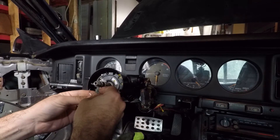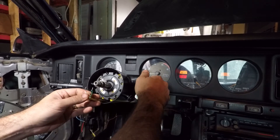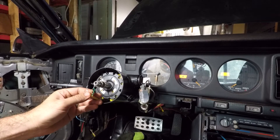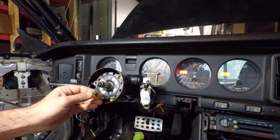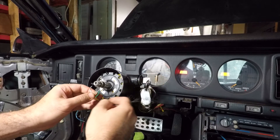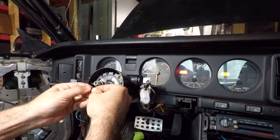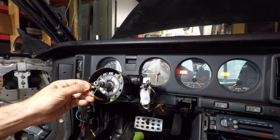Let's test this out. I'm going to put the key in the on position — the airbag light is going to come on. There it is, it's on. I'm going to touch the two wires together with the resistor in between and hold it here. I think it's going to take — if it works, it'll take a second.